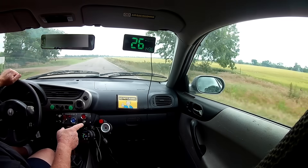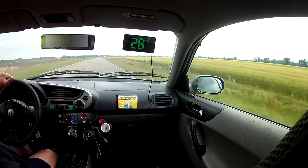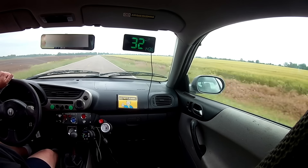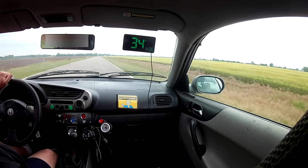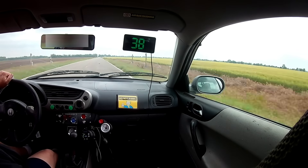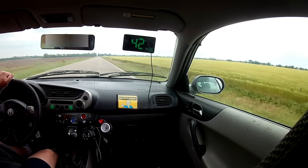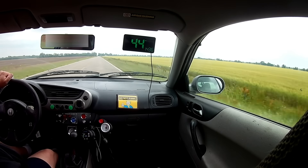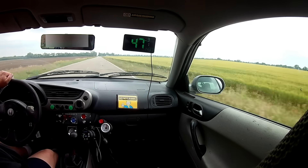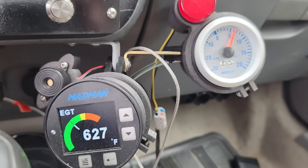I just put the car in fifth gear, and now I'm going to floor it. If the gizmo is working, we should see colder exhaust gas temps, the smoke from the exhaust should be eliminated, and we should see a reduction in top speed. A quick check in the rear view mirror — there's no cloud of smoke following me, so that's good. The car is definitely picking up speed, but it's taking a while. With the accelerator floored, exhaust gas temps normally go up pretty quick and can approach the danger zone in about 20 or 30 seconds. With five pounds of boost and our gizmo preventing the governor from slamming the fuel rack wide open, it's like the engine's on vacation. The exhaust gas temps are holding steady at a reasonable temperature, so no worries there.